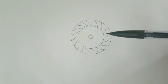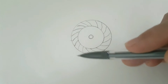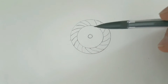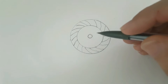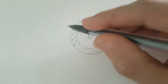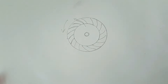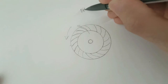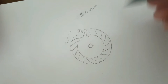This is a cutaway of your disc. If you cut your disc in half vertically, this is what you'll see inside. There is a series of vanes, and when your rotor is spinning with your wheel while you're driving, it acts like a turbine — sucking air in from here and pushing it out from here. The problem is, if you think about how fast your wheels are turning: even at 200 kilometers per hour, your rotor is only spinning at 1,400 RPM, which really isn't that much for a turbine this size.